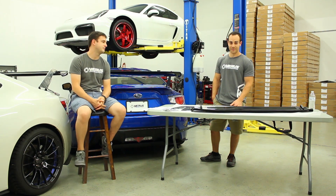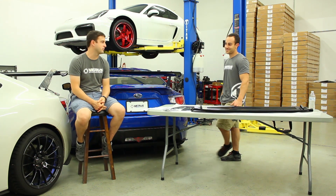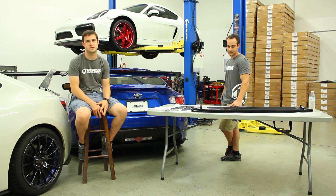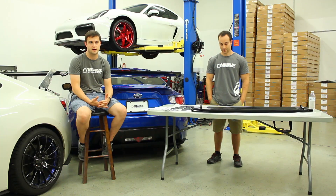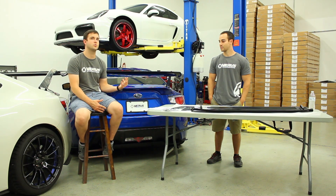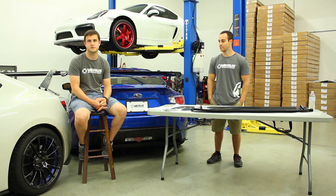One of the questions we've seen multiple times is why does the wing not have end plates. The wing doesn't have end plates first and foremost because of cost — adding end plates means two more parts, two more molds, which increases the price. Our goal is to make a wing at a decent price that we can actually sell to the average enthusiast. The other reason is that with the winglet design we can keep drag at a minimum without increasing downforce too much to the point where it would damage the trunk. The specific design of the end of the wing helps decrease drag while keeping downforce and cost down.